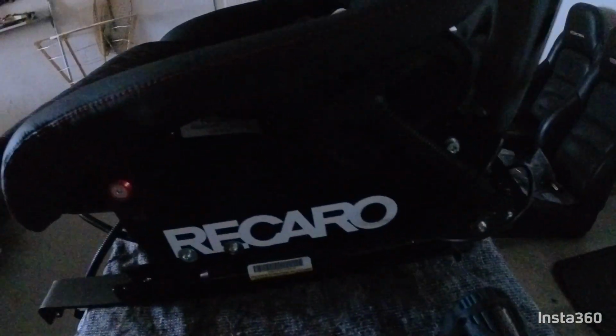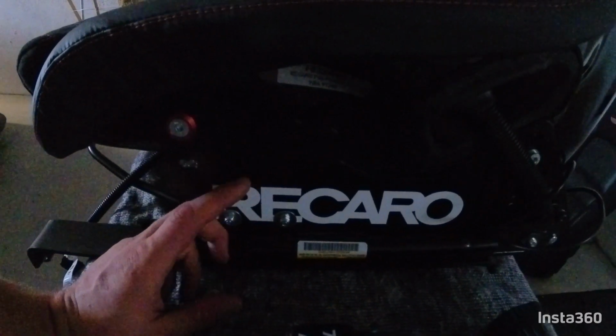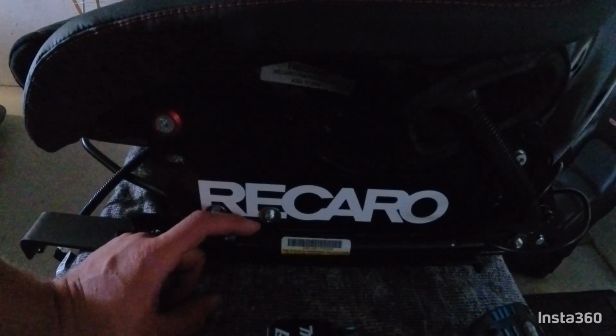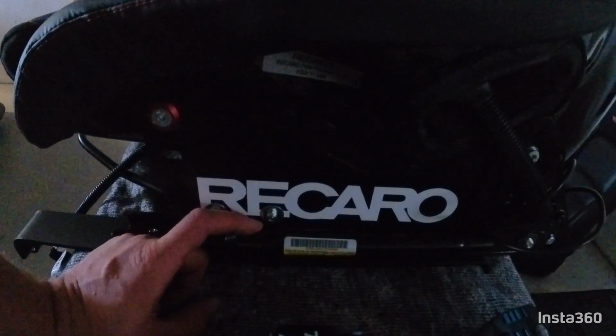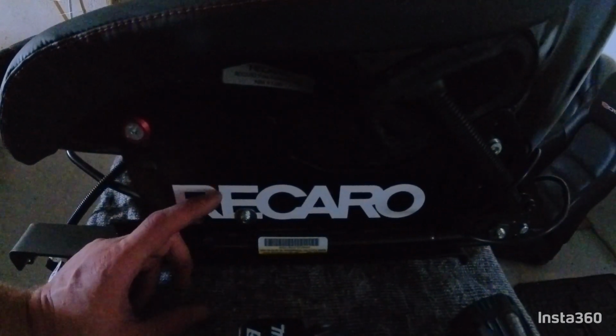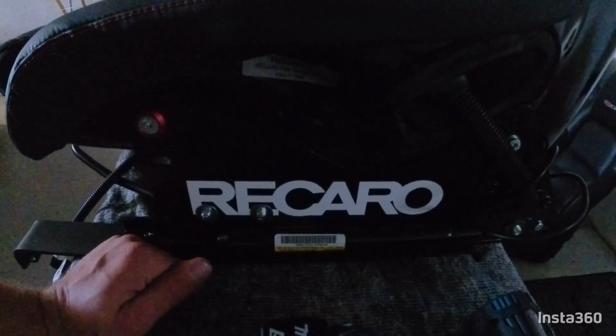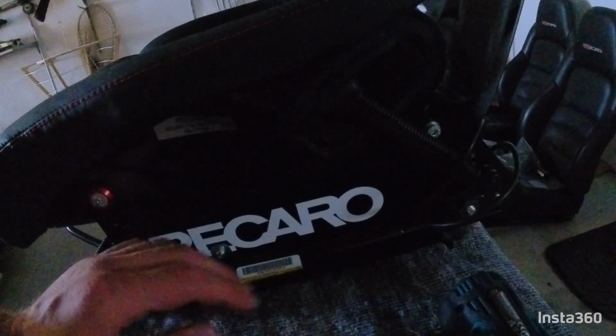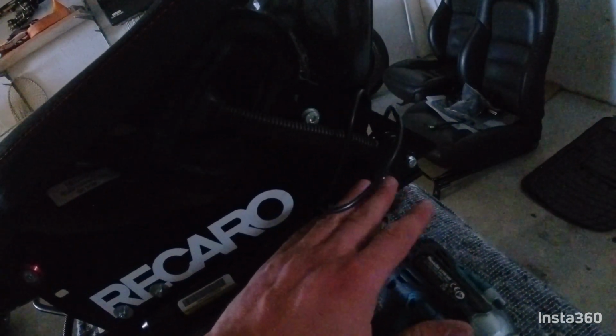The next thing you obviously need is your seatbelt lock, and in case of the C6 Corvette, that seatbelt lock has that tightening device. So in case you have a crash, this tightens your seatbelt and holds you in your seat so that you do not slide out and crash against anything. Anyway, I would highly recommend you to install this again on your seat. First of all, to avoid any airbag lights, and the second thing is it's quite sensible for safety. So I just took this off the original seat, drilled 2 holes, installed it on the aftermarket seat here.